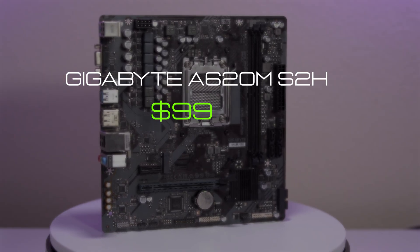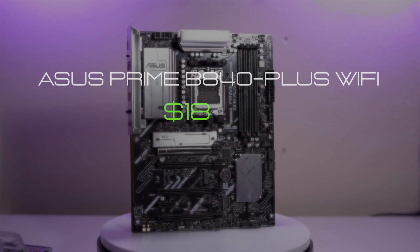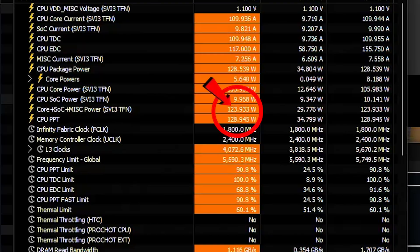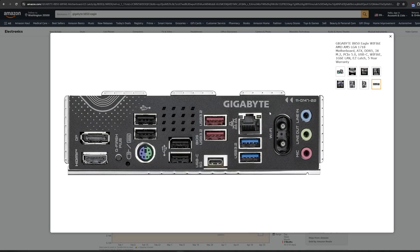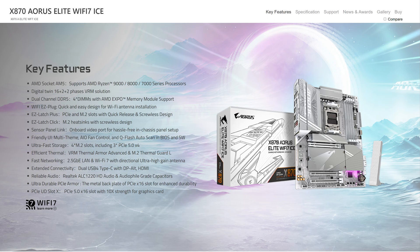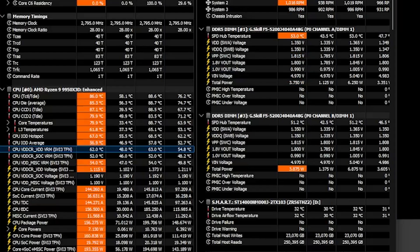Here's where we stand. Gigabyte A620M S2H: not happening. ASUS B840 Plus Wi-Fi: it's fine for an 8-core CPU, but put a 16-core in there and suddenly you have a VRM space heater — it's trying to gaslight you into thinking you need to spend more money to be worthy of a 16-core chip. MSI B840 Gaming Plus Wi-Fi: you want a 105W TDP limit? Gigabyte B850M DS3H: this is the one that actually has potential — not the best, but solid. If you need Wi-Fi, get the Eagle version. If you want a real motherboard, bite the bullet and step up to X870 boards — think Gigabyte X870 Aorus or similar with Wi-Fi 7. About $100 more, better I/O, 71°C VRM, no suckage.